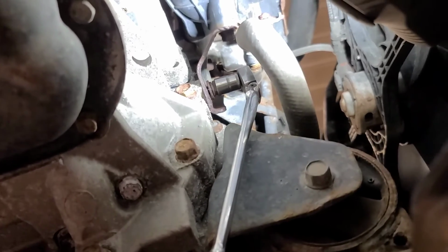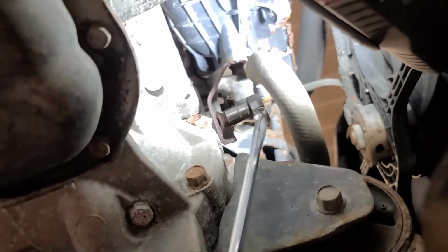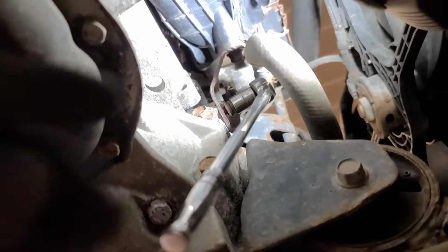So there is a brace from the back of the bell housing to the bottom of the intake manifold with what looks like four, probably 8 mil bolts with 12 mil heads. Have to take that brace out. I've got the starter loose in there, but it won't come out of there. I'm hoping that I can go back enough to get it out and down, and then go over in this direction here. Might have to remove this coolant pipe.